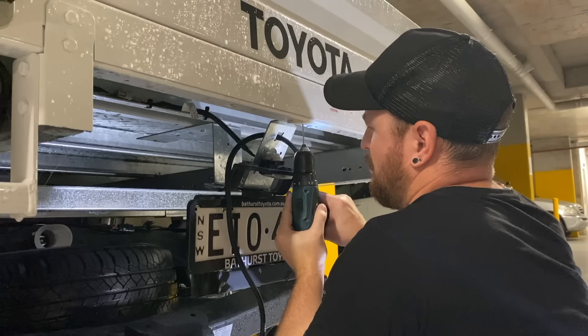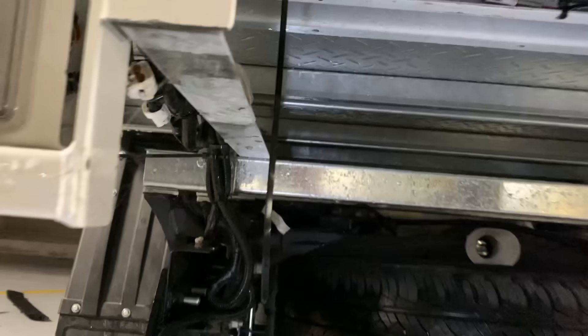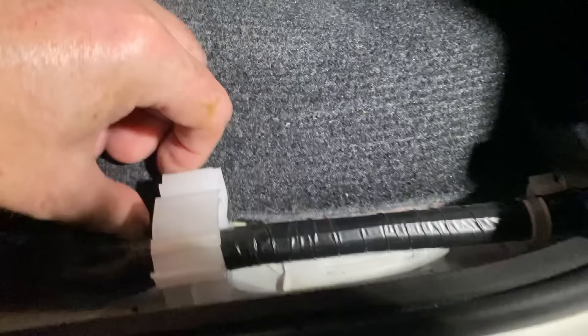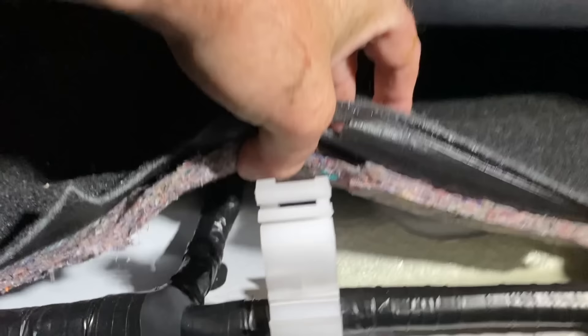Camera is mounted up nicely — just above the number plate where it gets enough light from the number plate light to see at night. It runs all the way along the chassis rail and then up to the front. The cable is cable-tied along here — I've left the cable tie cuts so you can see the run. Here's the passenger footwell with the plug in there ready to go. We come out just under the seat and lift the carpet — just under there is where we come out through the floor.